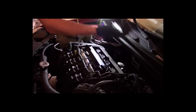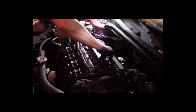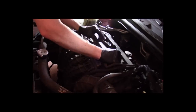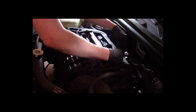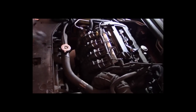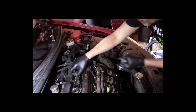Pull this coil out now. This is a bad ignition coil. There is no spark on this ignition coil. As a matter of fact, I'm going to take it out here. You don't hear any clicking or ticking. You're going to take this out, set it up against the ground, and connect it up. Don't have a good ground here. Let me grab my test light. Okay, got a test light connected to ground, checking that my test light has ground.